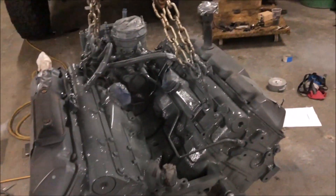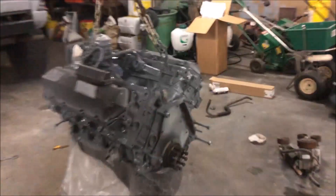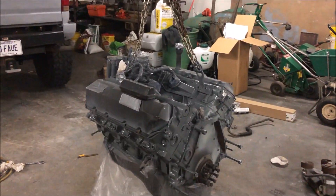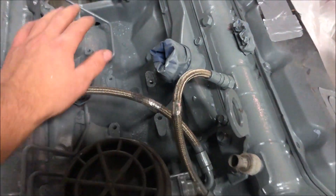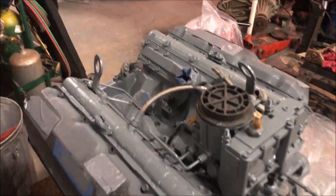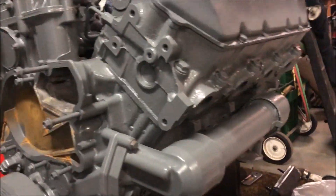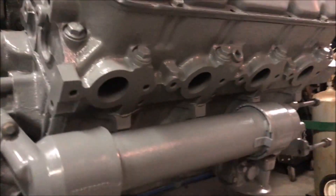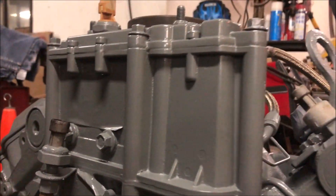The valley is all done up and a lot is still going to change. We had to paint it in order to get the new parts on — plenums and a bunch of other stuff. We covered the pan because I think it's going to look really good with the nice black shine. Paint's all dry now. I just took some of the masking off the sensors. I'm leaving the covers on the plenum holes for now so no grime gets in. The Ford gray by Dupli-Color came out really really nice. I definitely recommend putting the engine primer on first — makes a difference.